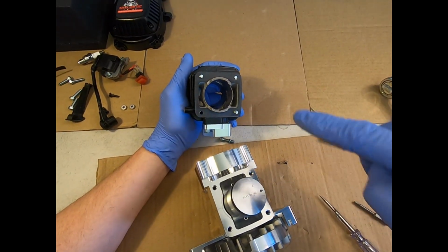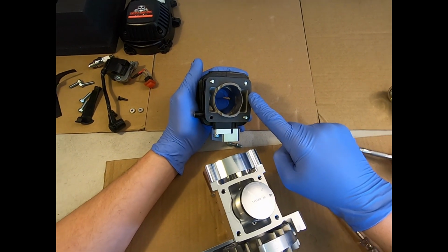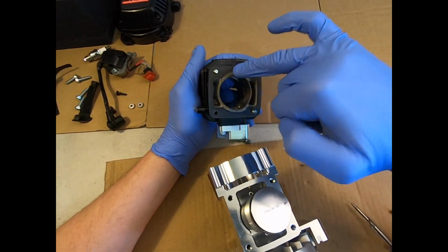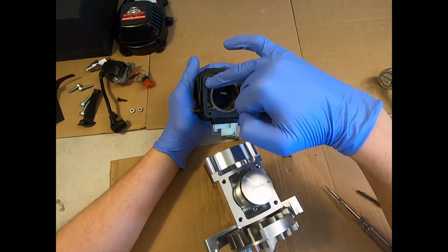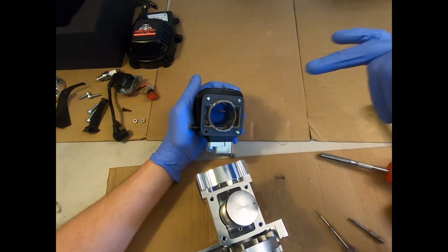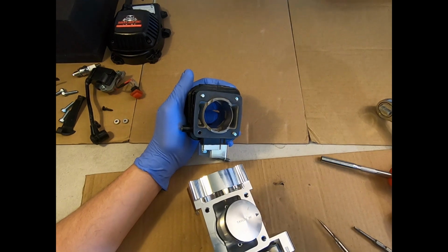But normally speaking, you will replace that every single time you service the engine, because it will have torn in some way, or even just little specks of it will have pulled out from the material and stayed stuck on the crankcase. So make sure you clean both surfaces fully. If you don't have, trying to think of simple tools, a brand new Stanley knife blade, that would be a perfect tool for the job.